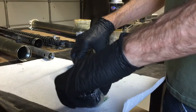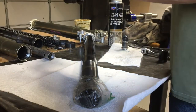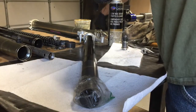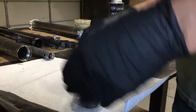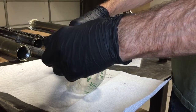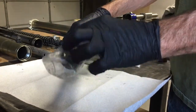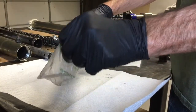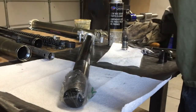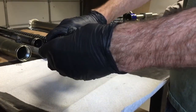We're going to put in the new seals and bushings. Remember to lube up the inside of the seals with grease — the dust seal and wiper both. On these forks, this edge right here that holds the bushing in place is very sharp and it can cut the seal really bad. So take a baggie at the end of it, put it over the top, put a little grease over it so we can slide everything over that groove without cutting up the seal.